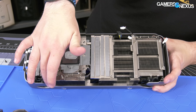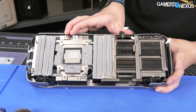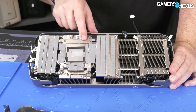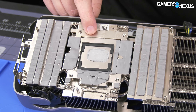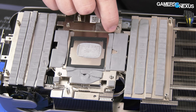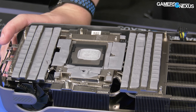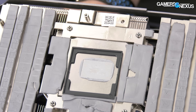Noise normalized, if you get rid of these fans it should start to compete with — or once you factor in frequency, supersede — the performance of the 4080 FE. Unfortunately the whole gimmick of this card is what's kind of hurting its competitive ranking. Regardless, the engineering here is really good. Take a look. This plate is probably responsible for some of their efficiency losses as well — it's connecting to the memory. You can see this is where the memory modules were contacting. They've got a separate strip of thermal pad here to try and contact the last inner edge of memory — didn't work out quite the way they wanted with the keep-out zones, but they still covered it, which is better than we've seen elsewhere.